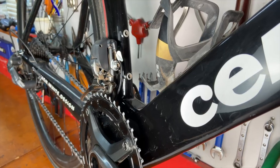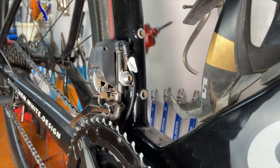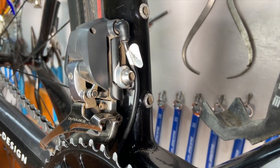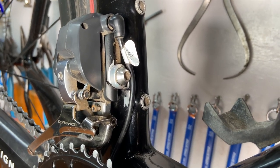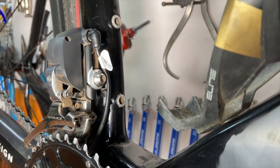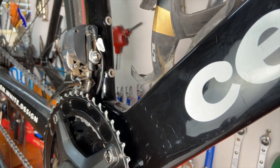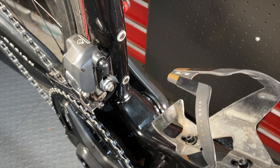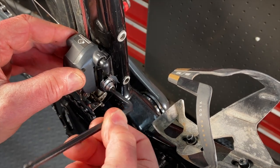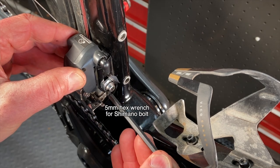It shows where the derailleur was so you can put it back. If you don't have the position marked, you'll have to re-find it — making sure the derailleur cage is high enough not to hit the chainring and that the cage angle is perfectly aligned with the chainrings to shift properly. I have another video showing how to set up a Di2 front derailleur, which I'll link to at the end of this video. Now we can install the chain keeper — remove the Shimano bolt and spacer and put the K-Edge bolt and spacer in its place.